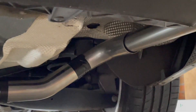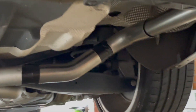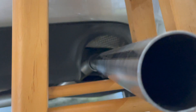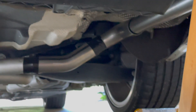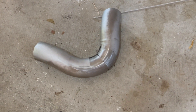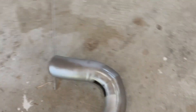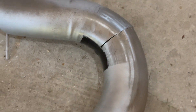Setup's all done. I was totally expecting to have to cut, add extension pipe, all sorts of stuff, but we've absolutely clutched this one. This 30-degree bend and 90-degree bend connected directly to each other, and the cutoff from the car already lines up exactly. I've got flexible exhaust hangers so a couple of millimetres of play doesn't really matter. I'm doing this on a test piece of pipe from the old system and I'm pretty much going to set it up the way I want the actual thing to be. I want to find out how quickly this tape melts — if it's good enough for a few seconds of welding just to tack it together, that's fine.